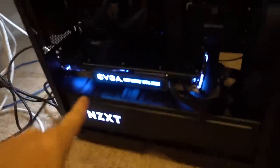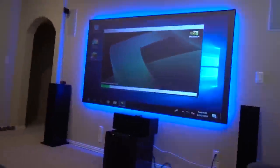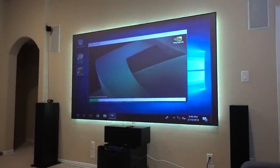All right. I know we've done a lot of troubleshooting in this video, but we fixed it. So the GPU is plugged in. It's working. It's functional. There's nothing wrong with the computer. The problem is this motherboard has an option where the PCI slot is disabled. And the PCI slot is the slot where the graphics card goes. So every time I would plug in the graphics card, the slot itself was disabled. Usually motherboards never do that, because that's kind of a weird feature, but I figured I don't know. It's really dumb, but yeah. When you're building computers, you troubleshoot a lot with a lot of different things. So yeah, but we're installing the graphics drivers right now, so we should be able to play some games and test this thing out.